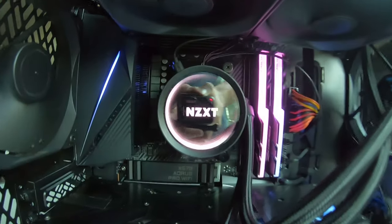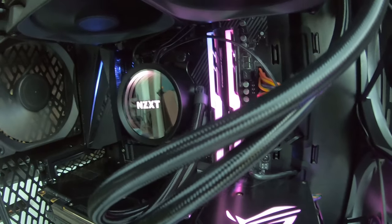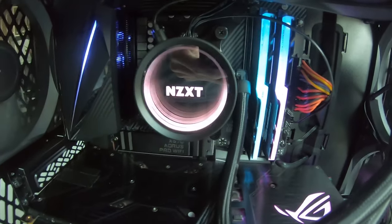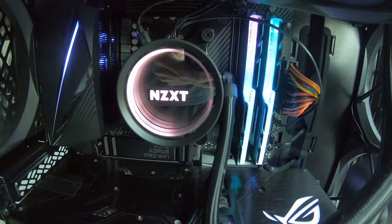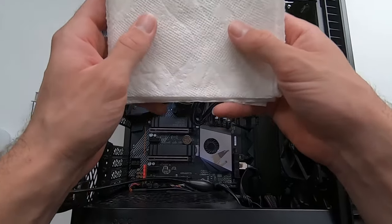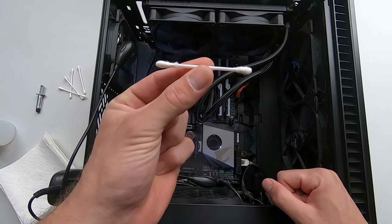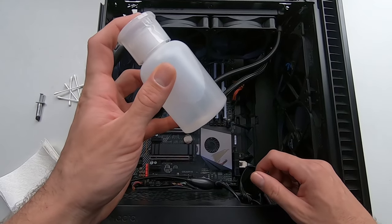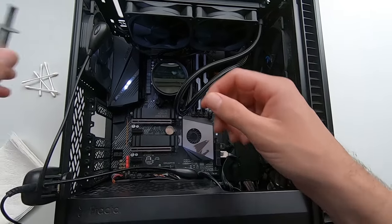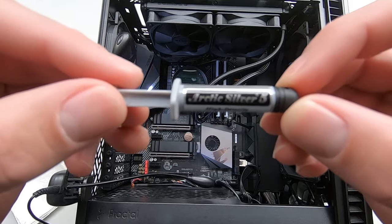The first thing you're going to need to do is clean off your CPU. If you're installing a brand new CPU this won't matter, but if you have old compound on your CPU, or even if you've touched the top of it with your fingers or anything like that, it's a good idea to clean it. So make sure you have that paper towel and cotton swabs handy. There are different liquids you can use to clean the top of the CPU but I would recommend isopropyl alcohol. It's normally easy to get, it's cheap, and it does a great job of getting rid of the residue.